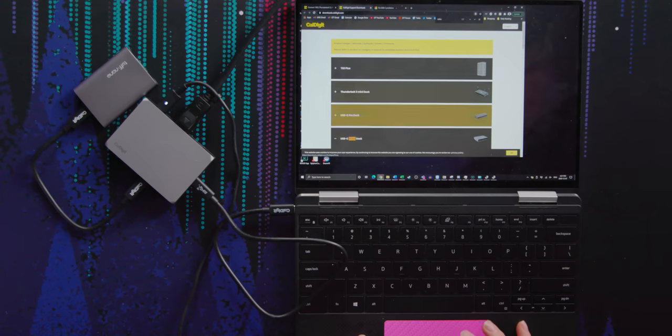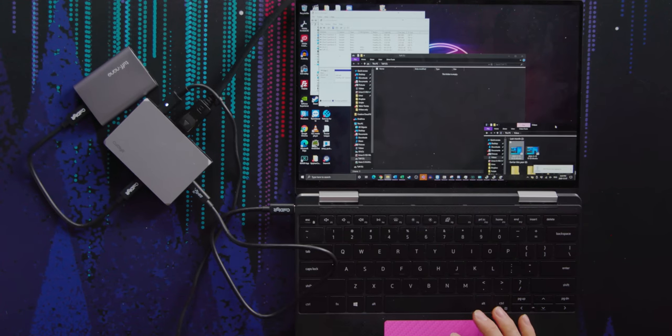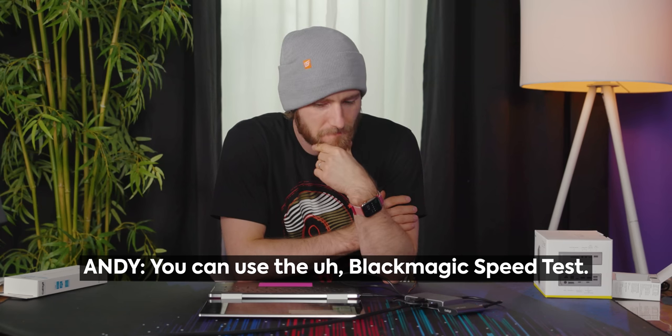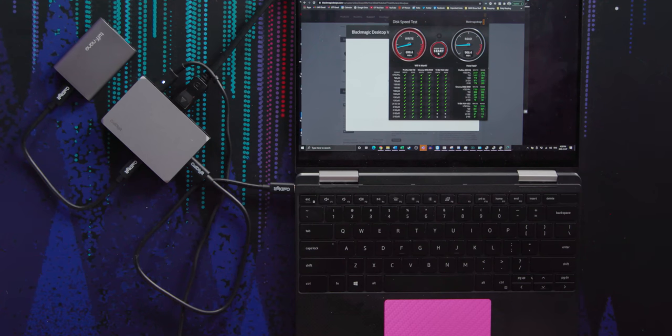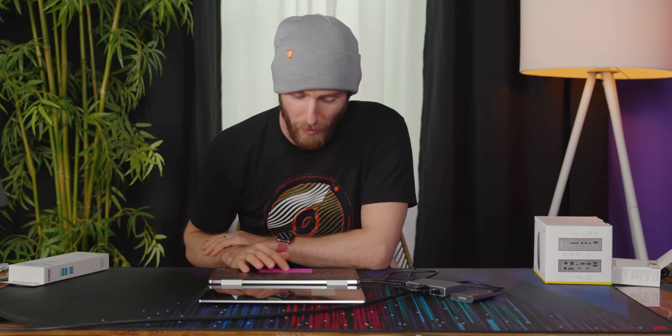We're at 144Hz and let's try to transfer some data to our external drive. One problem is that I don't think my internal SSD is fast enough to fully saturate this external one, but we'll find out. About 500 megabytes a second. Using the Blackmagic speed test — select target drive, start — 700 megabytes a second write. Not too shabby. That's not fully saturating 10 gigabit, but as far as external drives go that's okay. Read speeds are right up there: 900 megabytes a second. So as long as you're not trying to do 10-bit 4:2:2 4K 50 or 60 FPS, you should be in pretty good shape.